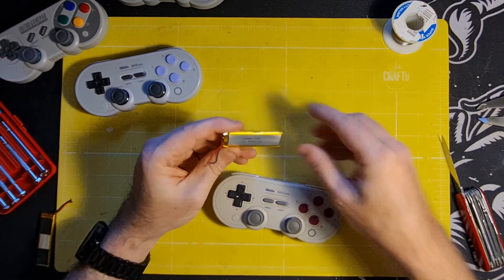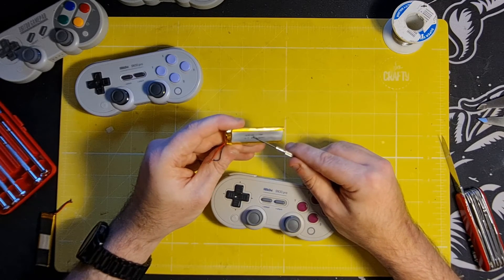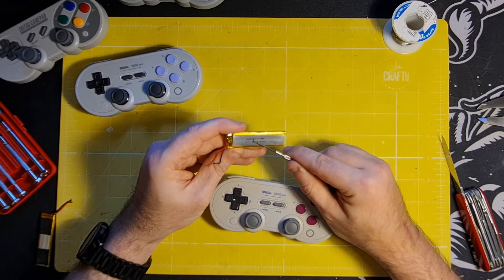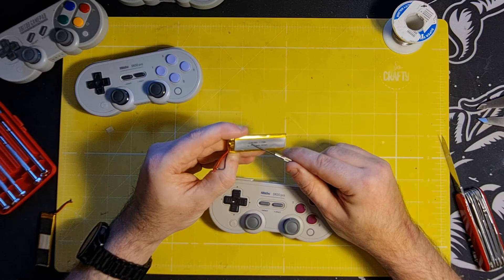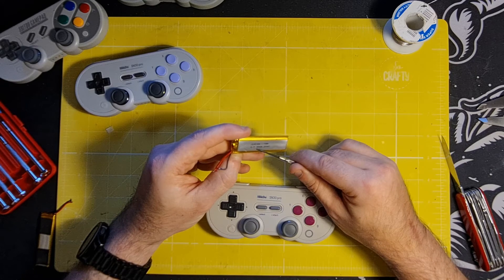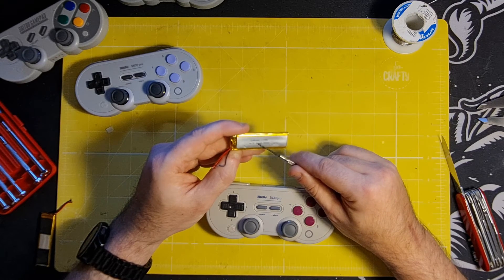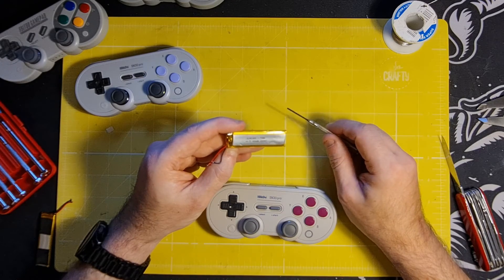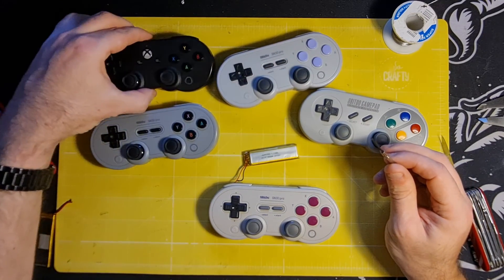You don't have to worry about getting a battery with exactly the right specification, as long as it's a 3.7 volt LiPo battery and the dimensions aren't too far out. I was able to get one that was much thinner but slightly wider, which fit nicely. I wouldn't get one any wider than 20 millimeters, but something thinner or even shorter would fit. I didn't want to get one with lower capacity either - the one I got advertises 500 milliamp hours, a little more than the original, so it's going to last a little bit longer. It was quite a cheap solution. I'll do all my other controllers in time as I work out which ones are actually failing.